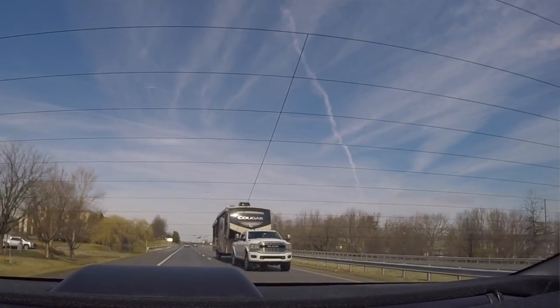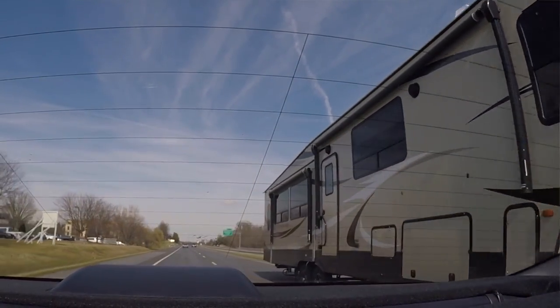The truck handles a little bit worse — 100%. The tires have definitely increased comfort. When I do the towing test I'll be able to give you guys a better gauge on speed. In the past I used to go 75-80 miles an hour. I know you guys get mad at me for going that fast, but when I go 80 it's at midnight with no one on the road and no sun, so my tires aren't going to heat up too much. My trailer tires are rated for 81 mph, so at 80 I still have capacity left. In daytime I normally go about 70 miles an hour — that's a good flow-traffic speed and I'm not going too slow.